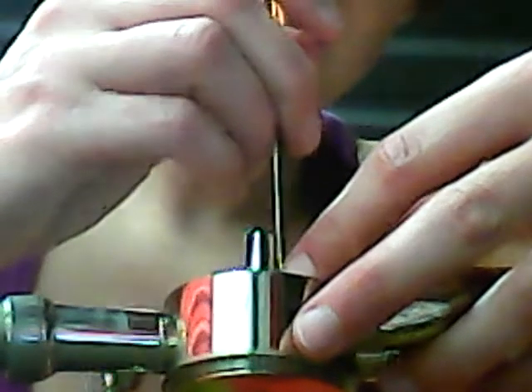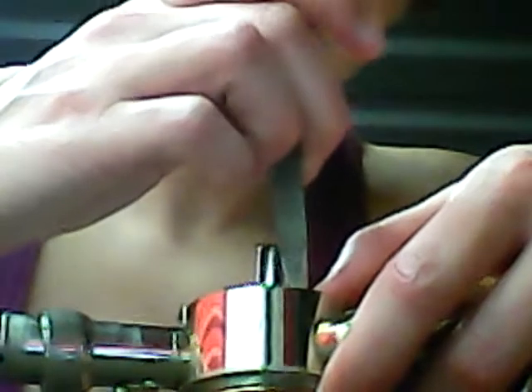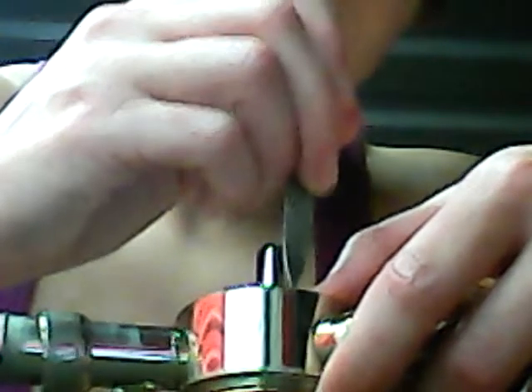What you want to do is hold the metal piece down against the rotor as you screw the first screw into the hole. The second screw is really small and it's going to want to move because it's greasy. Also press kind of hard, but be careful because the screwdriver might slip off. They don't want to go in very easily, like I said.